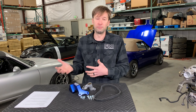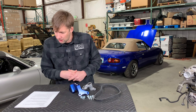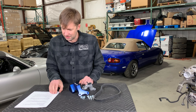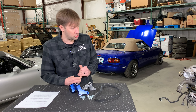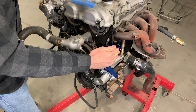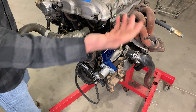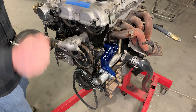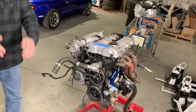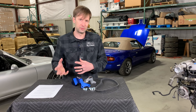That's why a lot of people - myself included - prefer a depowered power rack. Can the pump and hoses be left in place? No. This piece bolts in place of the pump using the same mounting points, so you absolutely cannot leave the power steering pump in place. If you did it super dirty - disconnecting the hoses and zip-tying them out of the way - that is not recommended. It looks ugly, it's going to puke out fluid as you turn the steering wheel, and the zip tie will fail into the belt. You do need to remove the pump and the hoses to do it the right way.